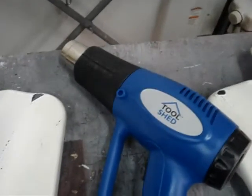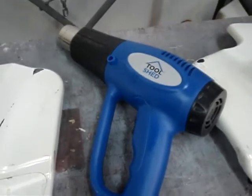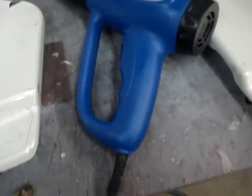Alright, on to the next step here. So you've got the old heat gun out. This is just a cheapie. It's got a high-low setting on it. There's no cooling fan after it. Just shut her off and let her cool down. Makes the job easy. I said we had these adhesive pads on here. They're put on there to protect the paint, stop vibration in a high rub area. So we're removing those. Apply the heat to them.